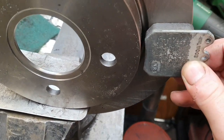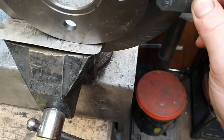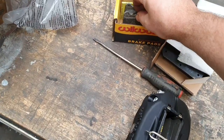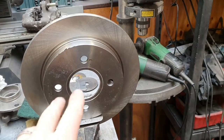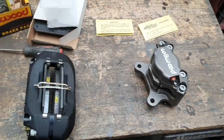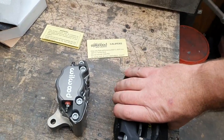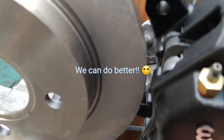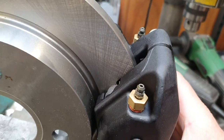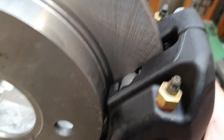The swept surface — contact patch — is not terrible. There's a little bit of pad overhang there, but that's not a big deal at all. Pretty good — it's essentially an OEM Ford Sierra part fitting on an Escort diff with an aftermarket pad and caliper. Not a terrible setup. The fronts are not as good as I'd like, but they'd be okay. You can see it's clearly looking for a bigger rotor than what we've got.